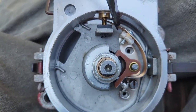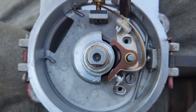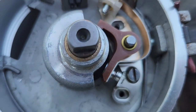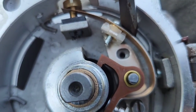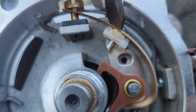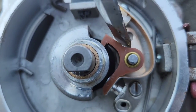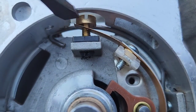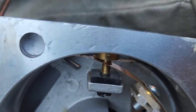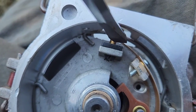I prefer to have a little bit more contact area, so we're going to sandwich the two pieces together and then screw it in. This strap right here has to go down here. The previous rebuild on this thing — it looked like that strap was underneath the copper, or I guess bi-metallic strip. I put it so that it is sandwiched between the two. My thought is better conductivity up to that strap — instead of just copper, you have copper and that steel bar.